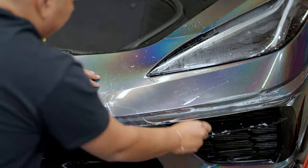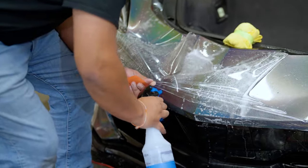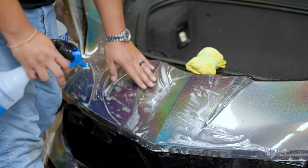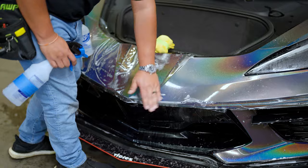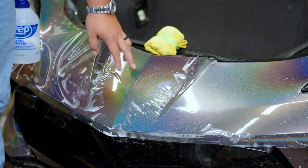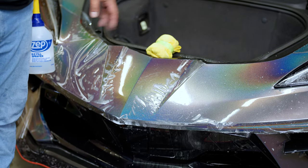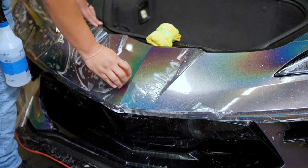You want to squeegee it down while at the same time holding it down. I'm going to spray some tack under our film, line up our edges, squeegee down the center. Now we're going to grab tack solution and spray it down the deep part of your body lines. So there are a couple of options for a pre-cut kit: if you like to de-badge your vehicles you can opt for the non-cutout, but in this case we have a cutout. So we can pull it off or we can leave it on. If you plan on putting the emblem back on, you just peel this off and it gives you basically your placement to have it dead center, as if it came from factory.